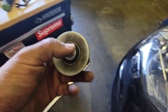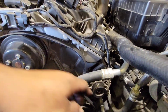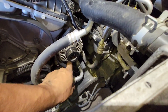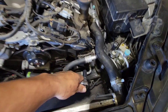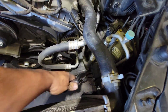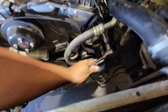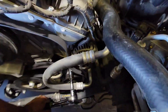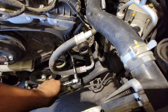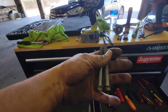Just break it loose and drive it out. Set this to the side. Now let's get to the alternator — it has two bolts, one up here and another right down here. These look a bit bigger than 14 but they are 14s. I'll need an extension for this one. Let's break these loose and the bottom one as well.